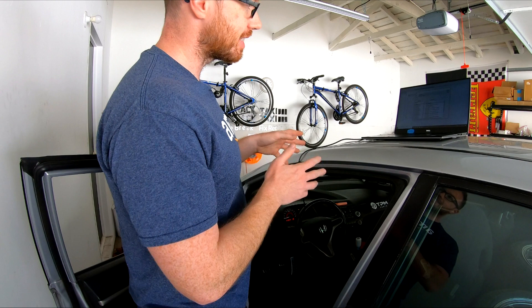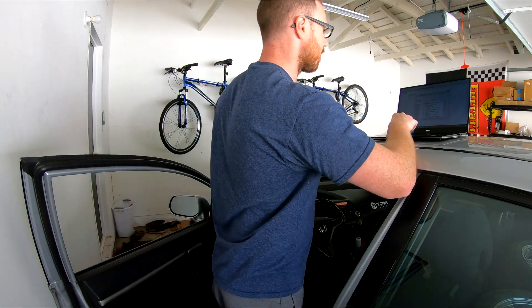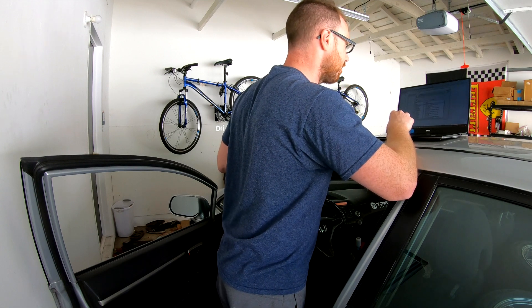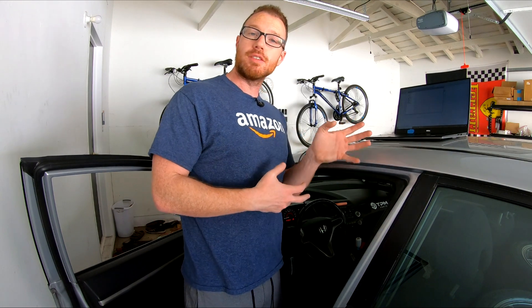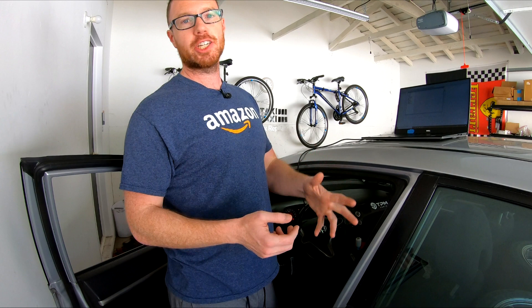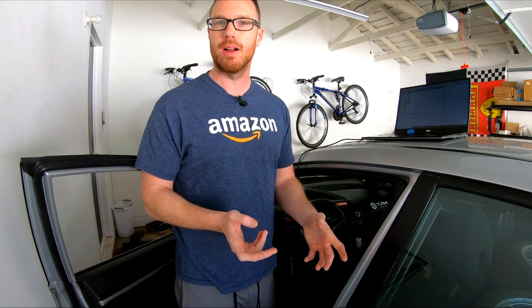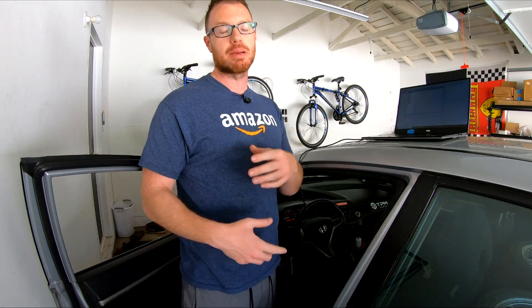But for the time being, with an otherwise stock car, if you go through the list of available maps, there is actually a completely stock FG2/FA5 tuned map. With this stock tuned map, we get a few things right out of the box. There are optimized ignition and fueling tables to hopefully produce a few more peak horsepower. But with a completely stock powertrain — no intake, no exhaust, no header, no cams — there isn't necessarily a ton of power to be gained just from that optimization.